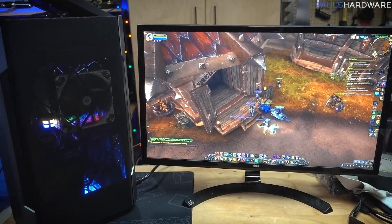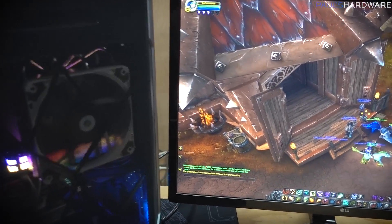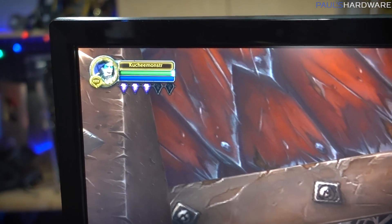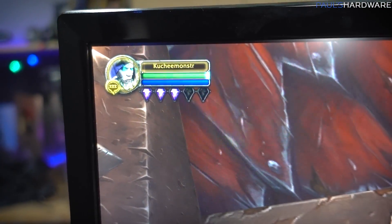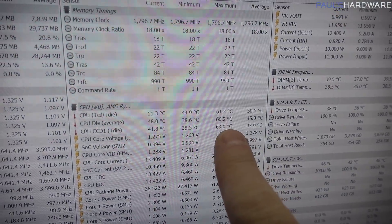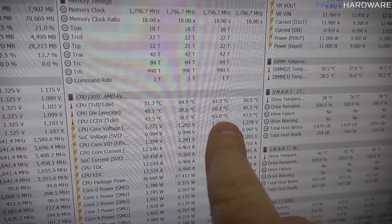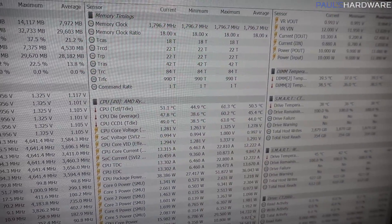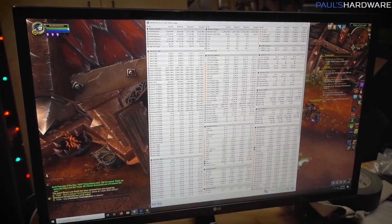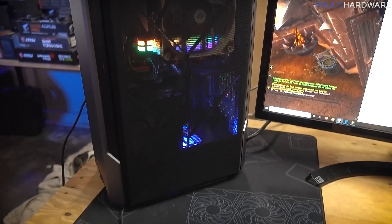Just to do a quick gaming test now that the CPU cooler is upgraded — I've jumped into World of Warcraft onto Chad's character called Coochie Monster, because of course it is. And we seem to be doing just fine. Maximum CPU temperature is what I'm looking at here, and we're not getting above 61-62C. So that's looking good to me, and I think we can call this a successful fix of Chad's PC that was shutting down by itself.